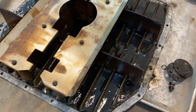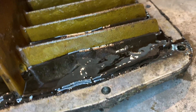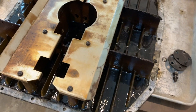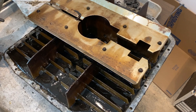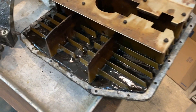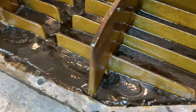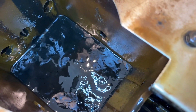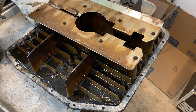I got the oil pan off, and there's a lot of sludge. It's all going to get cleaned out, but that's one of the reasons why I always cringe whenever I watch shows where they start a car that's been sitting forever and just put fresh oil in it and run it. This is what can happen when a car sits for a long time — the oil just sits in the bottom of the pan, and then the pickup is going to suck all that up and push it through the rest of the engine. Good thing we're taking it apart and cleaning it.